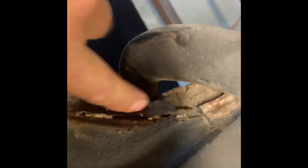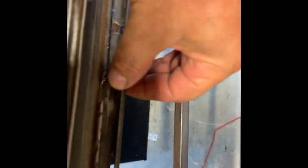Right. I'm starting to make the gutter on this car, and I'm missing a lot of sections here, and I don't really care about these little things in here because when I seam seal it, that won't have any effect. But obviously, I have to fix any holes in the gutter and cut it out. It seems like the whole backside of it is good, which means that I'll probably cut the bottom out or cut the edge off.